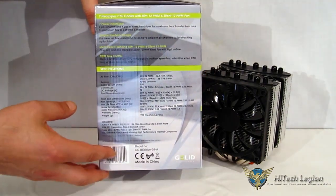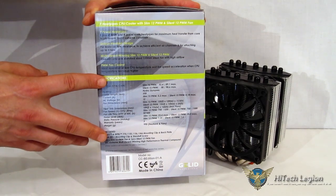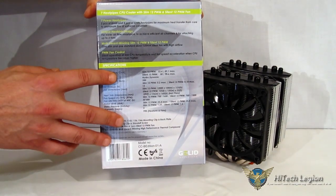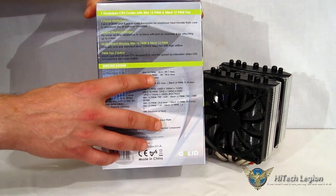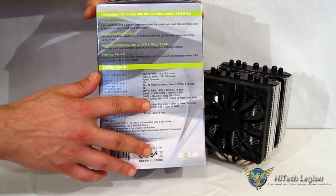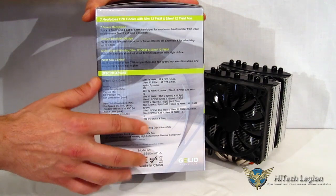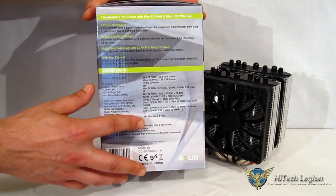Going over to the side, we get some actual specifications. The Black Edition is compatible with all of today's sockets: AM2, AM3, FM sockets on AMD, as well as 1150, 1155, 1156, 1366, and 2011 on Intel — also backwards compatible to 775. Taking a look at the airflow, you get up to 89.1 CFM on the slim fan and 98.6 CFM max on the silent fan. Both are very quiet — 25.4 and 25.5 dB respectively at max load, which is 1500 RPM on the silent fan and 1600 RPM on the slim fan. The unit itself weighs in at 990 grams with fans attached — substantial, but not incredibly heavy. We regularly see dual tower coolers over 1000 grams; this comes in just shy of that.